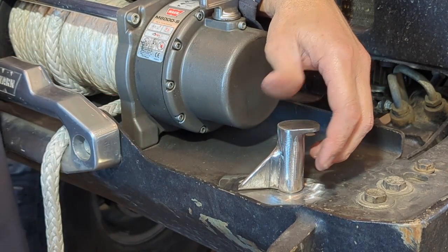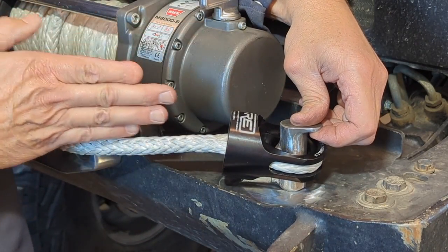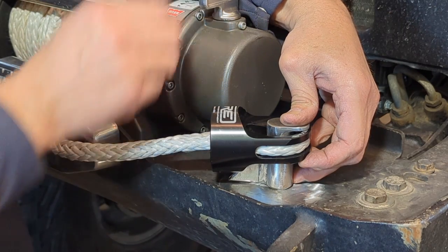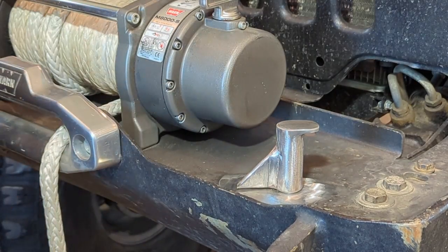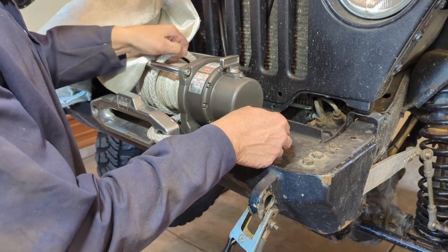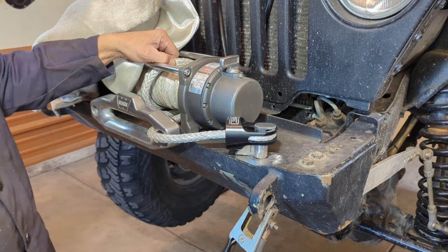The reinforcement will go in line with the rope. The safety thimble comes over the top and connects right through just like that. I need to make sure the reinforcement spine is lined up in direct line with where the winch rope is going to pull. As it gets snug it'll be about a quarter inch from each side — out of harm's way and easy to use whether I go free spool or winch out. I got it tacked in place; doing a couple of test fits. When you pull on this it comes up, evens out, and lines right up with the reinforcement spine. Clearance is about a quarter inch on each side — exactly where I want it. Time to burn it in.